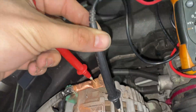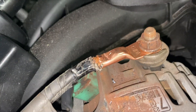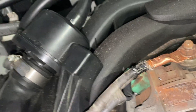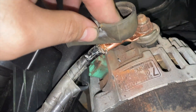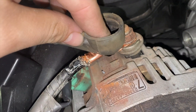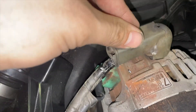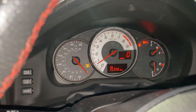I tested the alternator with a multimeter to make sure it was giving out the correct voltage with no voltage drop. The car's been running for a while just to make sure it's not gonna heat up. Before it was burning and you could clearly see the smoking at the beginning of the video. Now it's clearly not burning me — that's a step forward. At the time of recording this, it's been a while and I've had no problems, no more battery light flickering — everything is good. Don't replace alternators for fun; fix it yourself.